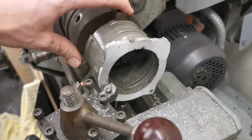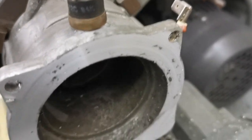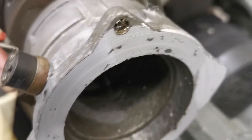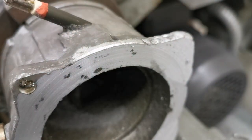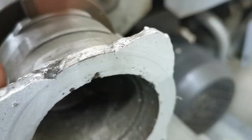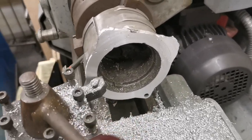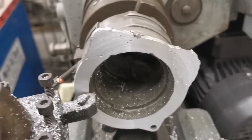We've got through now so that it's flat, but we're going to have to keep going a little bit more to try and get rid of some of these corrosive holes. I've been going at five thou per time but I'm going to wind that down now to two and a half thou per pass. I'm going to stop where I am now and keep chasing cavities.